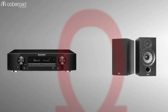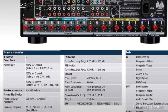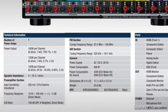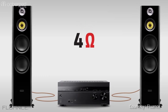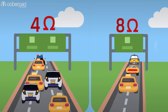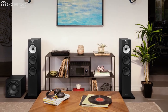You'll need to match the number of ohms between your receiver and speaker. This information is available in the receiver specifications and is usually listed by channel. Some manufacturers will also include their recommendations. If your receiver or amplifier is running with lower impedance such as 4 ohms, the speakers will receive more power — similar to how more cars can move through a highway with more lanes. If impedance levels don't match, you may cause permanent damage to either your speakers or receiver.